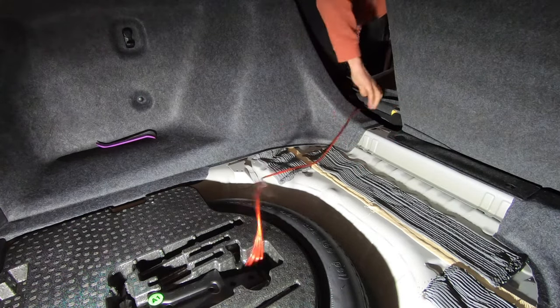I just tested it — got everything wired up. It doesn't look pretty right now but I just wanted to test it, and everything seems to be working exactly how I want. It has quite a bit of bass for what it is; I was kind of surprised. This is the finished product — you can see the wire coming out here. I still have to notch this out so the panel will close, but it comes around here and then I have the fuse here. I might wrap some black electrical tape around it so you can't see it. It looks very factory still. I'm not going to show putting everything back together since it's just the reverse of taking it off. I hope this helps somebody and shows the process of where to route the wire. Thanks for watching.